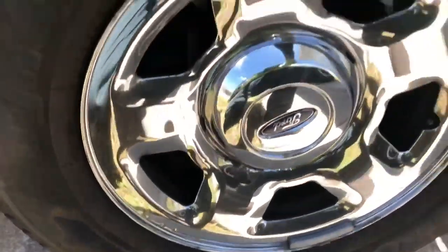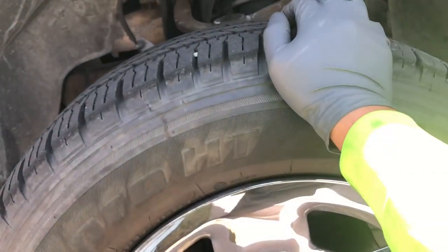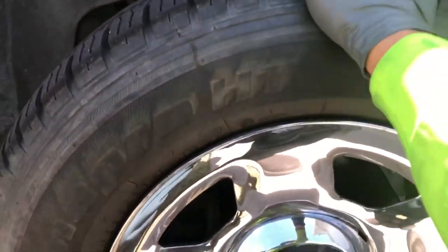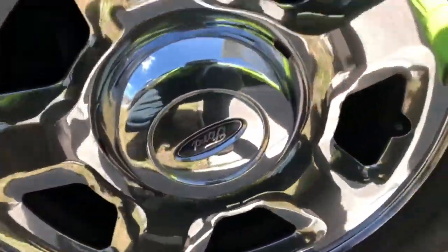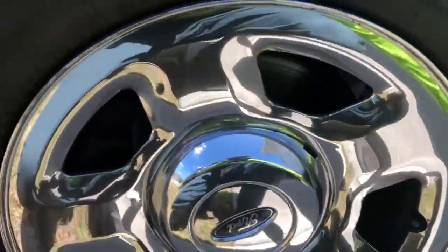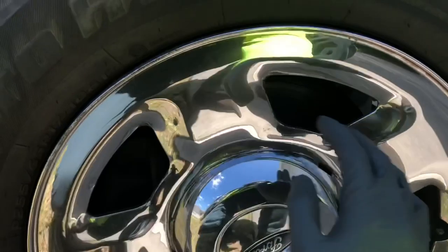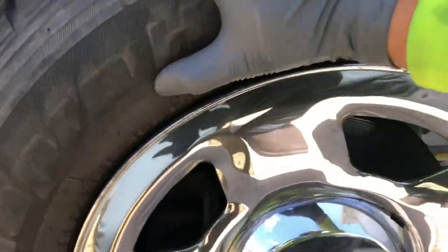The bearing is weak, which will lead to a shaking bearing. I recommend safely jacking up the vehicle and supporting it on jack stands. So as you can tell it's off the ground — you want to check for wheel bearing play up and down and left and right. Up and down: no play whatsoever. Left and right: no play whatsoever. But check out the shielding in the back — I checked it, it's not touching the rotor at all.